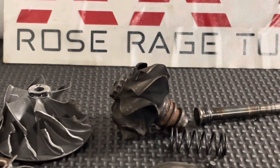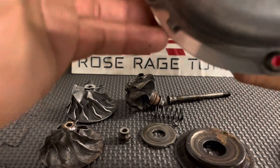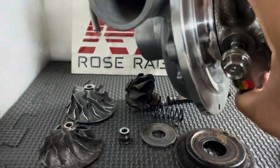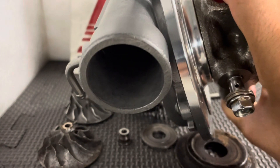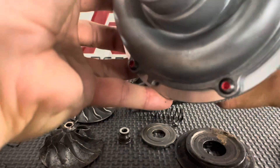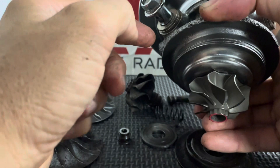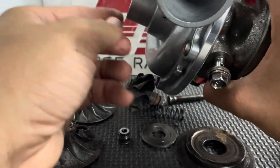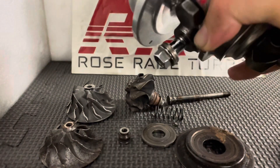This is no longer the case — we have just recently developed the centre ball bearing housing. I've got a lot of parts developed for these ball bearing repair kits, but I don't like selling them individually because even turbo shops get it wrong. So I will only do it myself. I've got billet backing plates made. Billet comp wheel done, turbine shaft wheel done, heat shields we can get. Within reason, yes, we can repair them. We're now trying to get the actual bearing housing done, and we've now got the bearing housing completed and can do our own rotating assemblies — the main bodies.